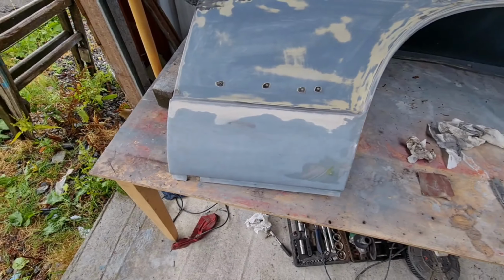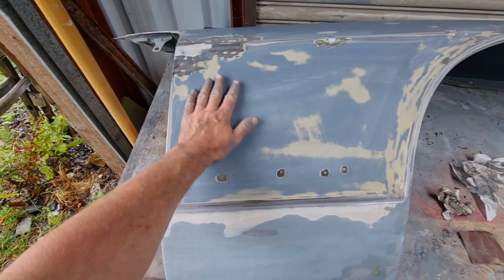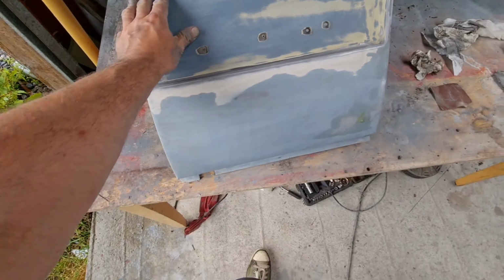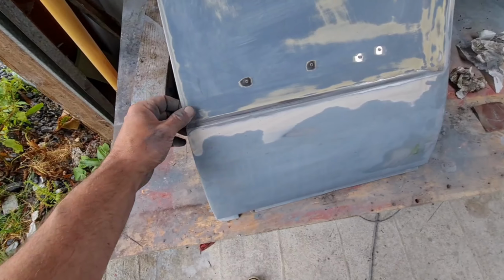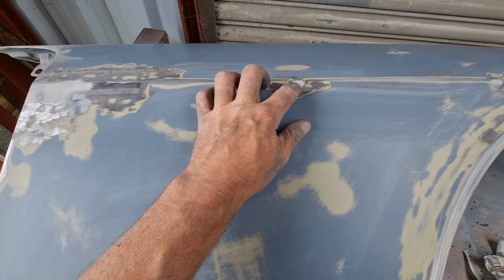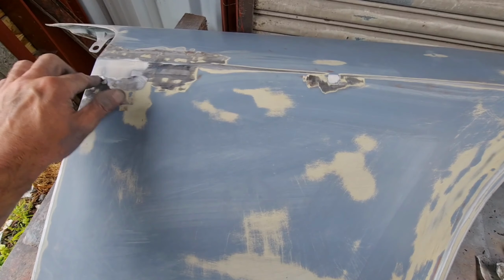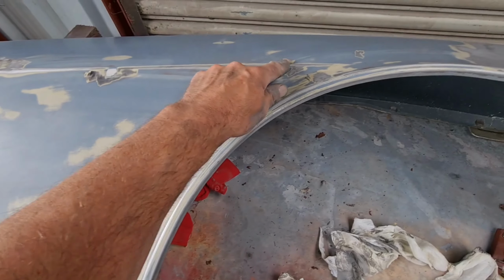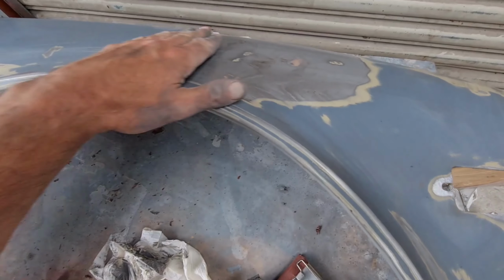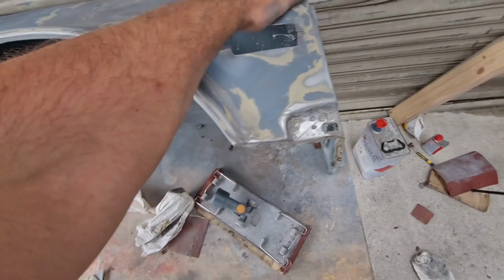That was an entertaining many hours, and we've gone right back underneath the paint and we're down to these two sub layers of primer. I made a few decisions as I was going along. I found that my border between wherever I was filling before crossed over onto the paint, so I wasn't going to take that chance. So I backed it all off so that there's no paint underneath this, and I'm going to redo them. We uncovered a new area that was filled back in the day. Don't know how old that is. And everything else seems to be okay.